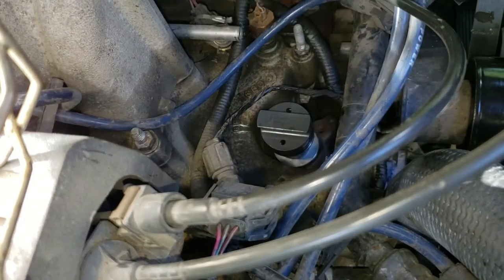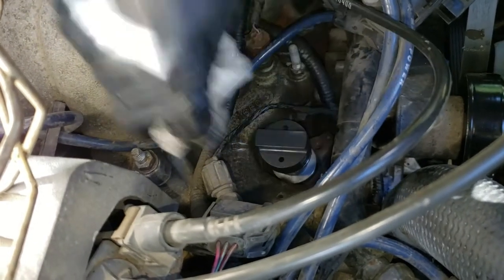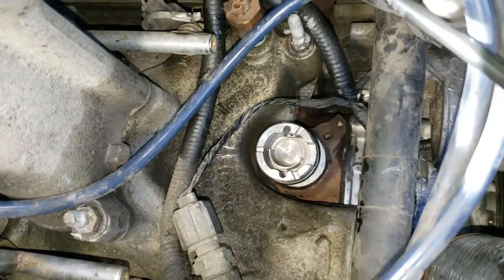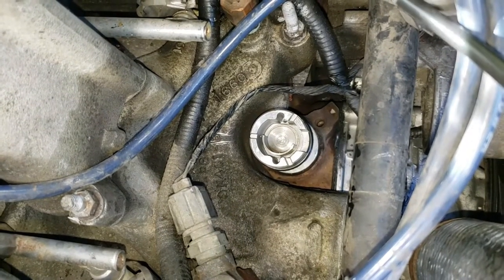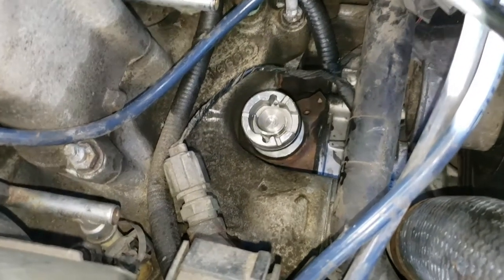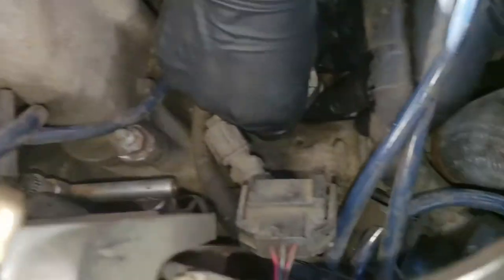As it drops in, the gear causes it to turn. Now, if we did it right, see? Hey, that looks, to me, 180 degrees out from where we want it to be. No, it's in the right spot. No, we go back and look at our pictures. Oh, the center is in the wrong spot. The sensor is 180 degrees out from where I believe it's supposed to be.